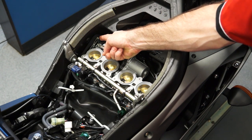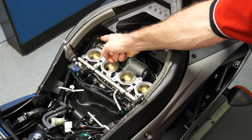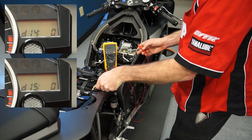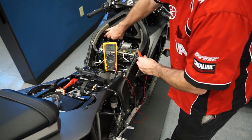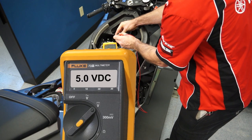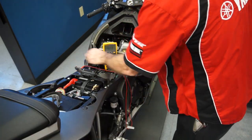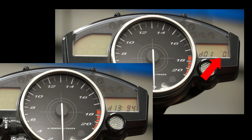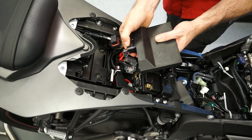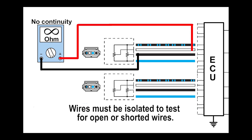If the YCCT system is shut down due to a failure, the ECU will not supply power to the drive motor. To check the working range of the TPS, you will need to manually open the throttle plates. If the pair of Diag Mode values are zero, this most likely indicates that the 5 volt supply wire is open — check for voltage at the sensor and then at the ECU. If the supply wire tests okay, test the sensor itself and check the service manual for exact specifications. If only one Diag Mode indicates zero, this could indicate that the signal wire may be grounded or that the sensor has failed internally. Isolate the wire, verify that it is not shorted to ground or another wire, then replace the sensor and retest.